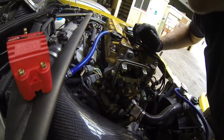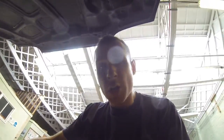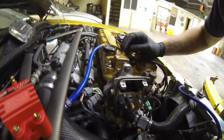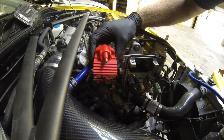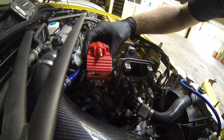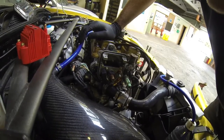I've had a look online, googled some pictures of what other people are doing. A lot of people mount it here or have it back here with the big red wire running across - no, we're not doing that. There's one guy in the UK who's got the right idea - he's basically come off of these timing bolts, which I didn't really want to do, but it's not the worst case scenario. We can make a plate and just mount it there, giving us a nice short wire to the cap. The only thing I need to do is run one wire in somewhere, but I can make a little thing off the bracket for that. So I'm going to find a sturdy piece of steel plate and get that built.